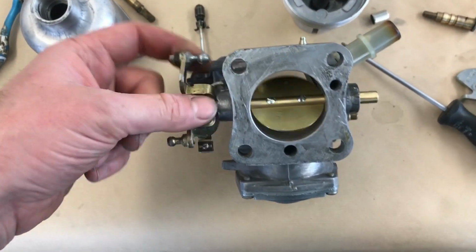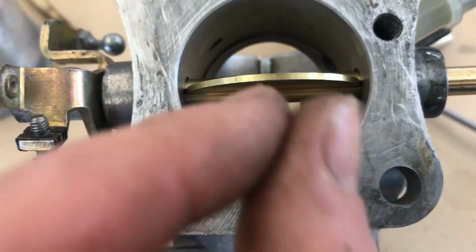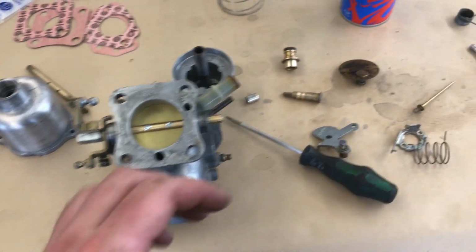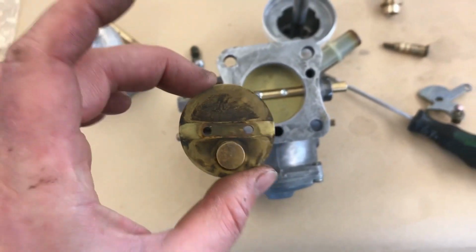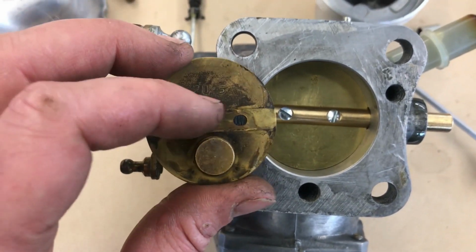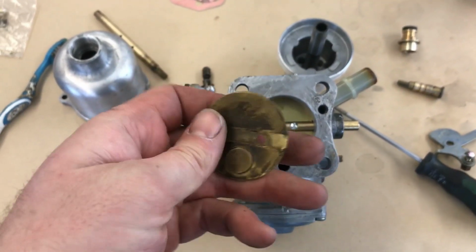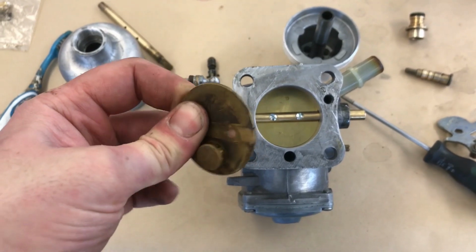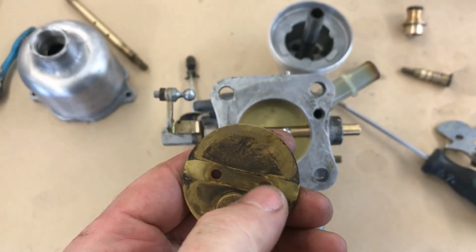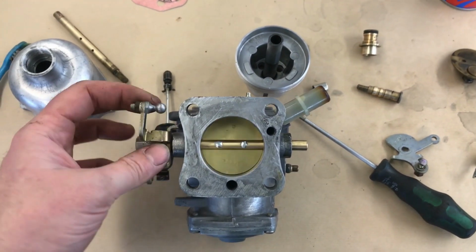Butterfly in. Screws are in. I just need to stick a flat blade screwdriver in them and open them up so that they can't rattle loose. The seals are in as well. Just as an aside, if these do go a particular way round, the way I looked at it is that the numbers, if they have numbers, are stamped on the side that runs into the engine, so that as the throttle disc shuts, the overrun valve opens, sucking air in. One is an ovaled hole, this side, that one's round, so that's how I've done it, and it seems to work rather nicely.